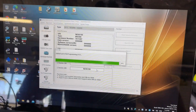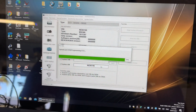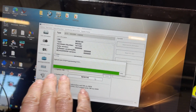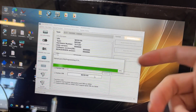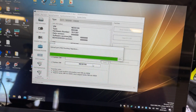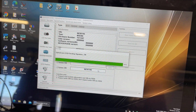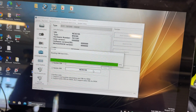We'll see. All right, since it's nearing the end of this session, I thought I'd start filming at 98, 99%. So when you're flashing the modules with WinKFP, it'll do, I think, a main flash. It verifies the flash, then it writes the UIF information, checksum calculation, checking signature. So I think it's verifying the flash. Signature okay. So let's see what it does for upload part 2.